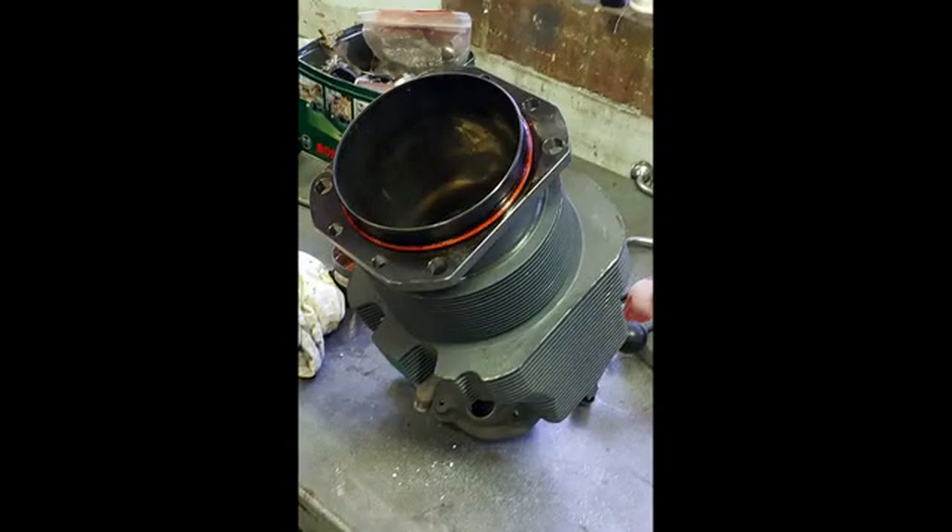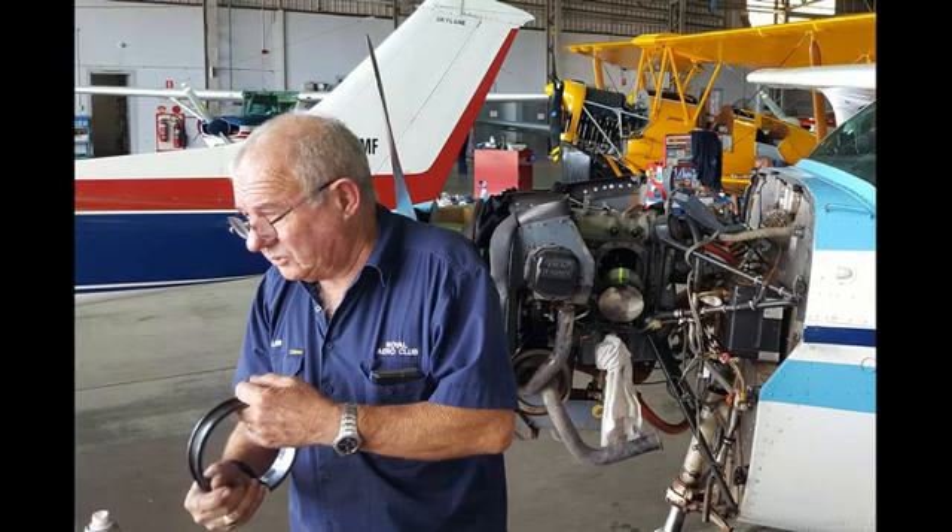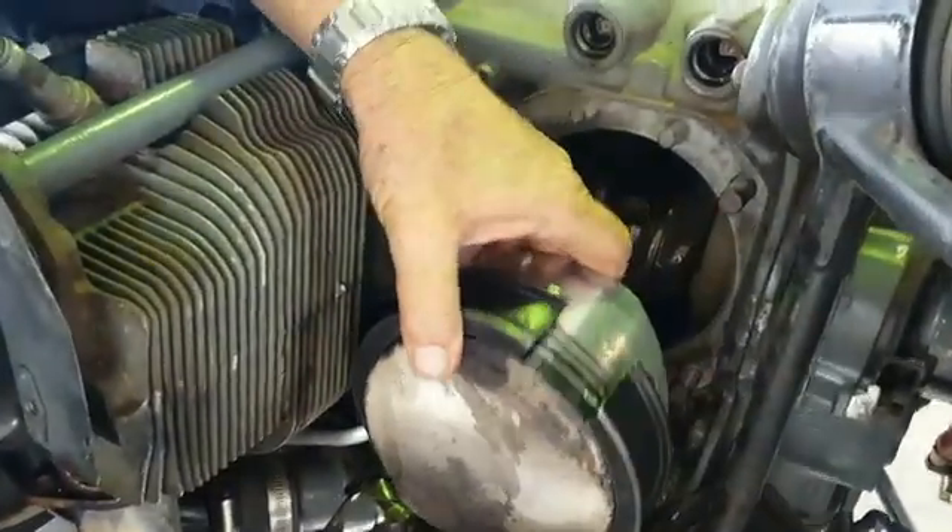Here's a picture of the cylinder again and you'll see on it the red oil seal at the base of the cylinder. We're back to the aircraft and we're going to put the cylinder over the piston. If you look to the right of Lou, above the rag, you can see the piston hanging out of the engine. In his hand Lou has a special device to help slip the cylinder over the piston. In the next video clip, as Lou puts the cylinder back on, you'll see at the base of the piston the connecting rod and also the crankshaft.